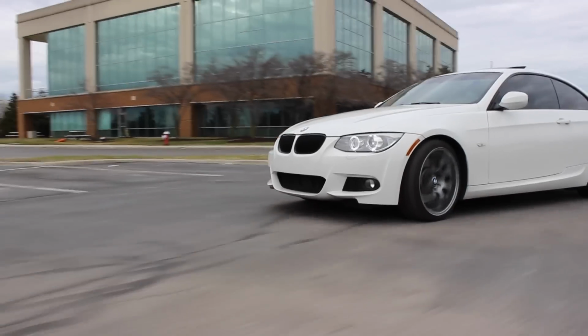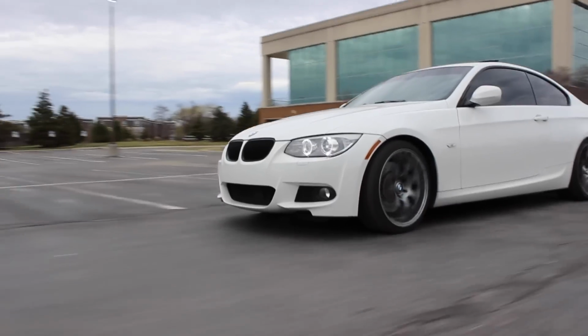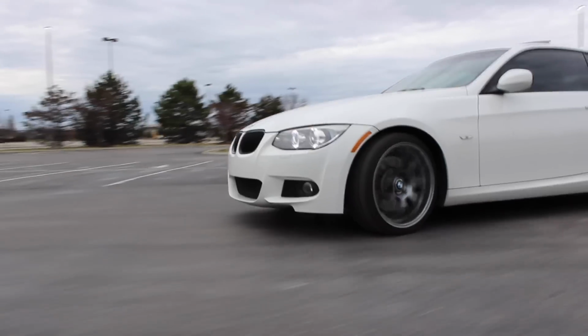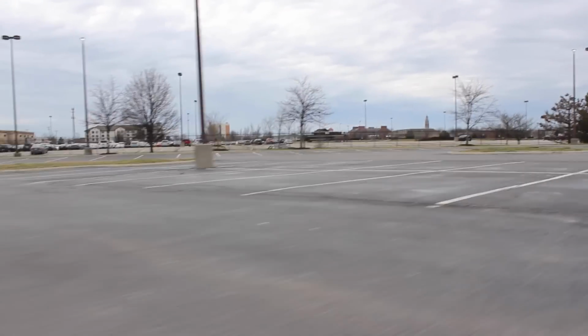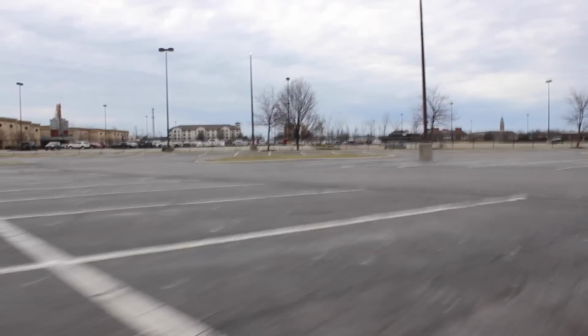It does rub when I'm on the highway like I'm at now, 60, 70, 80 miles an hour, and there's a bridge, and I go over the undulation, and it goes. You've probably heard it in other videos if you've watched my channel long enough, but that is definitely something to think about. So you definitely want to pay attention to the width of the tire. I have to roll my rear fenders because, as time passes, I realize that I hate the rubbing, but I really do like the 275s. I think I'm going to stick with them.